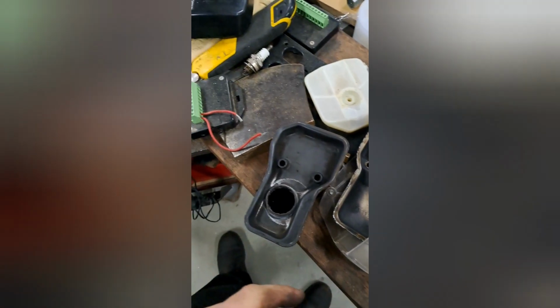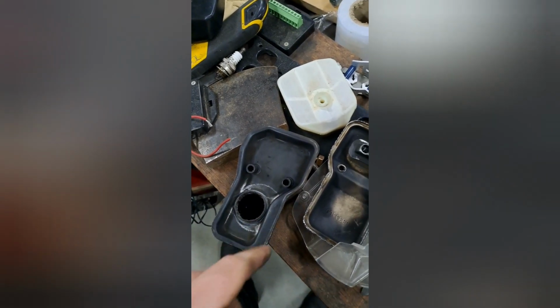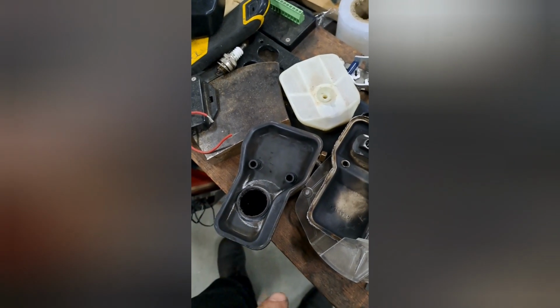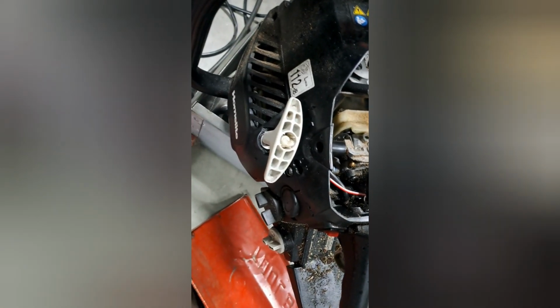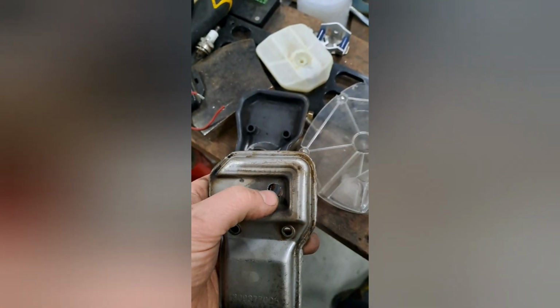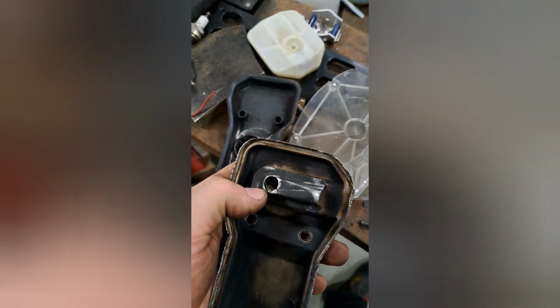Alright, this is where I'm at now, just tweaking this muffler apart. You've probably seen a couple of photos. I might post them here. I took the cat out of this Homelite. Just a cheap Homelite, it came from Bunnings. I think they were like a $99 Homelite at the time, but they're like $120 now. Took the cat converter out of it. Just drilled that hole a bit bigger, got rid of the flange that was on it, and just punched a hole for the guts of it.